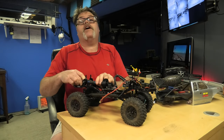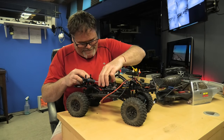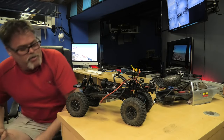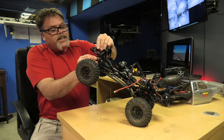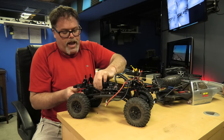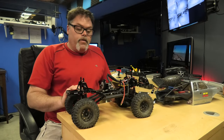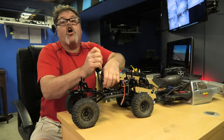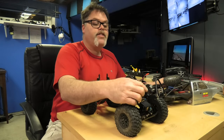This is just a really cheap transmission from China. This should have made it to my Don't Buy Junk video, by the way - I had to rebuild it right out of the box. But it's too late for that now, so we might as well keep carrying on. There's another screw down in here, right in the bottom. Just stick it right in there and you should be able to find her. Oh yeah, there it is. So we get that one out, pull the cover off, have a little gander. By the looks of it, we got that tightened as tight as it will go. So we'll tighten this thing up even more - just crank right on her. And that should stop it from slipping. Let's give her a try and see if we fixed her as easy as that.